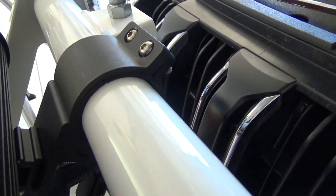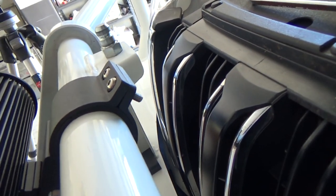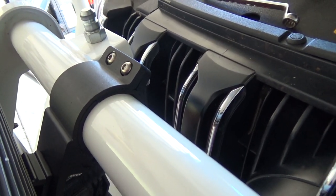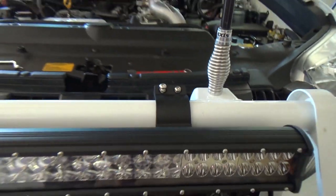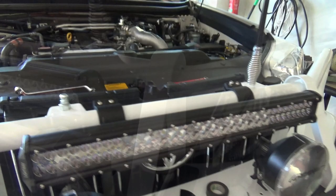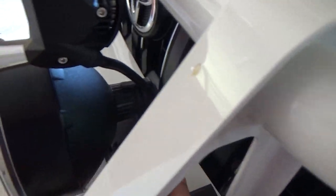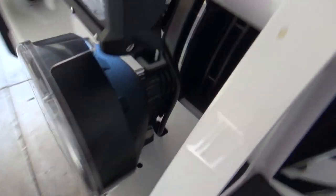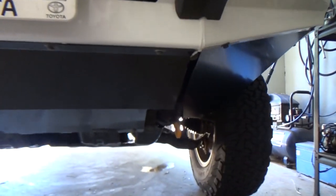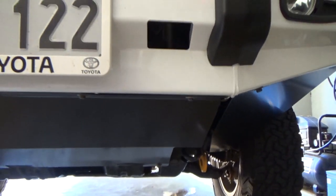So once I put that extra insertion rubber there and tighten them right up, they're actually quite nice now, beautiful, and hugging that bull bar top pipe quite nicely. So I'll just finalise the second one and finish the rest off. So the power wire for it goes down there, and I've just got that poked down the same place as the other spotlight in the ARB cutout. So what I'll do now is take that tray off so I can get access to the underneath and wire them in.